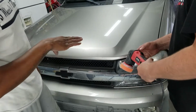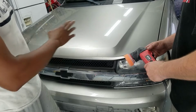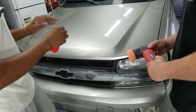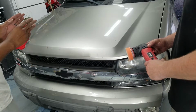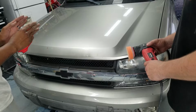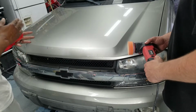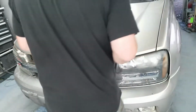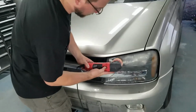Okay, so I'll put it on one when I turn it on, and then since we've already got the polish on, which I usually do like one to two, I bring it to about four or five. And you want to work your polish roughly an inch per second. So if you think of a one-inch line per second, it's not real fast, it's a slow progression across the face. Okay. Well, you can slap my wrist when I'm doing it wrong, because I'm probably going to get it wrong. This is the power. Yep.